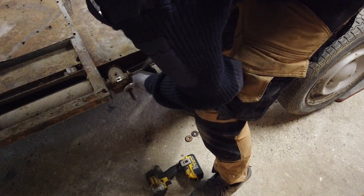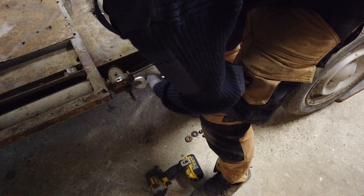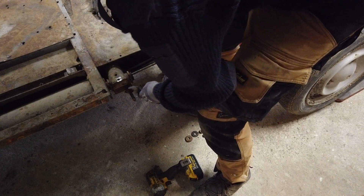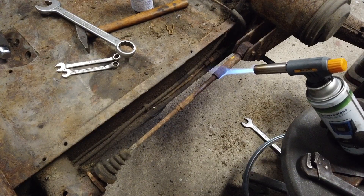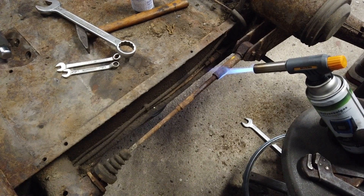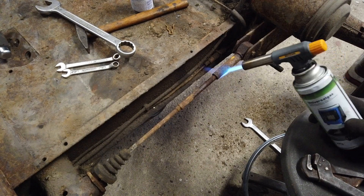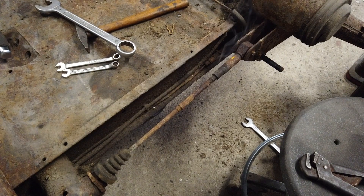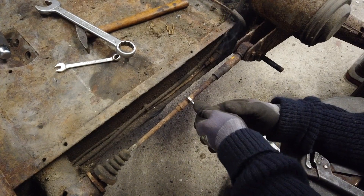I'm tempted to go and buy an induction heater at some point because that seems so clever — expensive, but clever. A gas torch like mine is just fine to heat things up and make them easier to work on. I'm going to try the same right here, heat it up and hopefully get it to spin. This is actually what controls the ride height on a 2CV — it needs to be adjusted from time to time, and really often you see wrongly adjusted 2CVs. It's supposed to ride at a specified height, which is a bit different on the Mahari because of weight. And it worked!